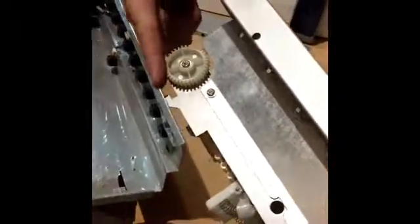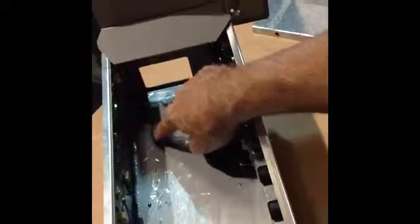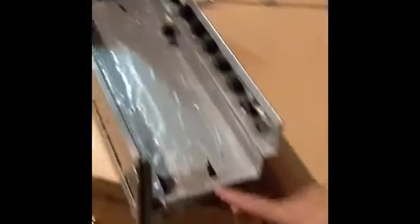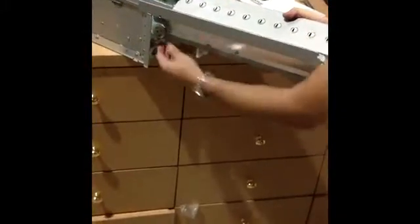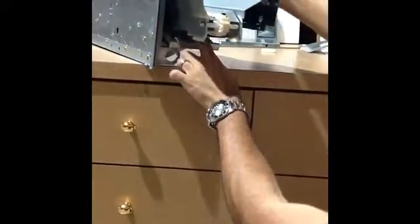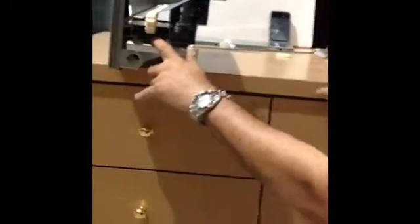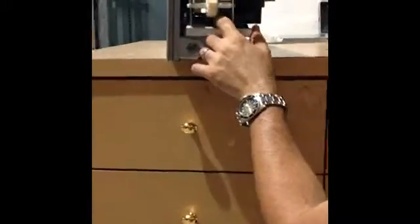The important thing is that this white cogwheel lands on the black cogwheel for the band motor. Let's do that in action — we hold this part down, line up our grooves, push the tab down, and start moving our basket in. Once it gets to the back, it's going to want to land in its grooves, so make sure we're inside those grooves.